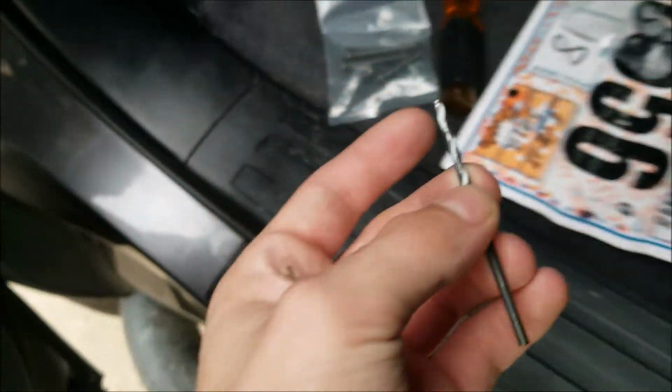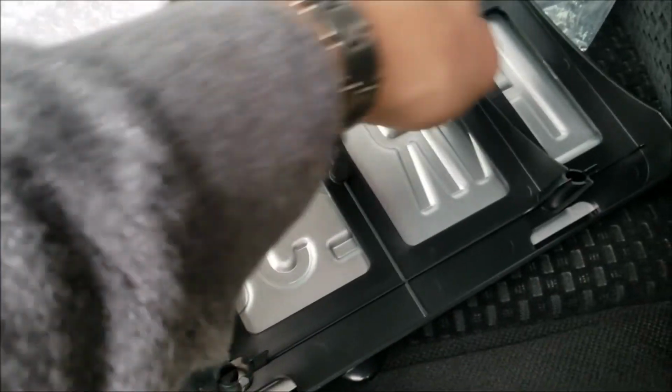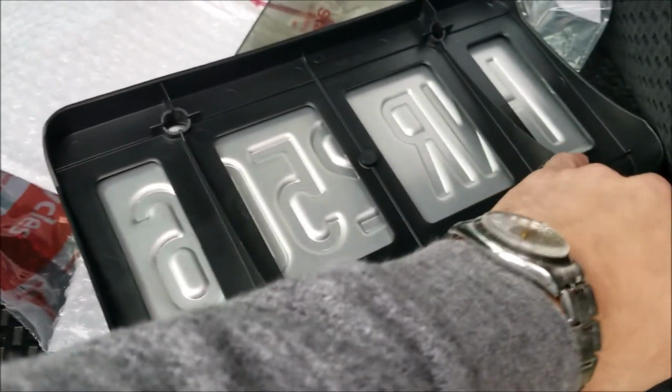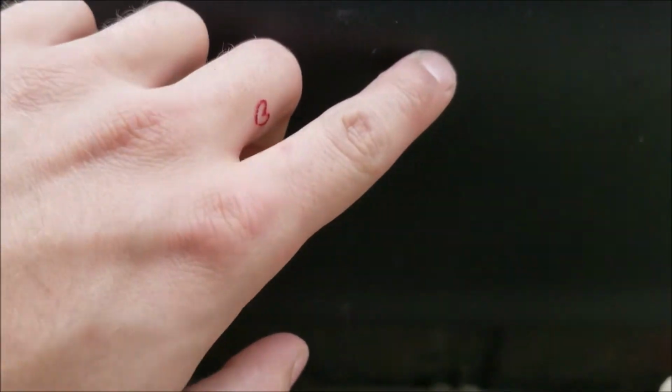Alright, so here's our pilot hole. Now you'll notice in the bracket, four holes, which correlate to four dimples on the truck, and these two are actually hard to spot. So, I already lined it up. It lines up. If it doesn't, deal with that one. You see, you got a dimple here, and almost underneath here, you could barely even see it on camera, but that, and then that little guy. So we're gonna go ahead and pilot all those guys.